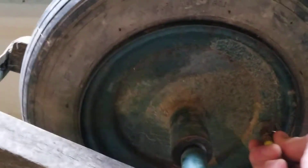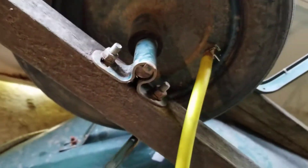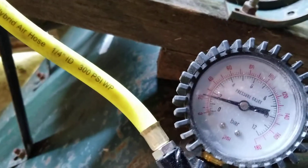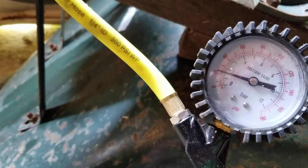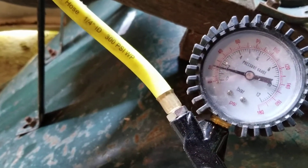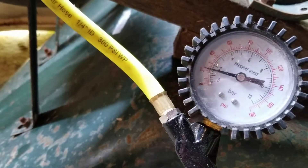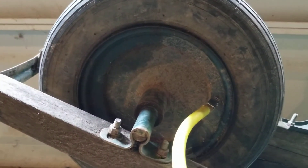My stem came off — you want to be very quick as you go to inflate once you get it seated. You can hear my compressor kicking on, and you can see I have it at about 20 psi now. That should actually drop, because when the propane ignites it gets really hot and expands a lot, and then as it cools down the pressure will drop. Temperature and pressure are related.